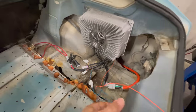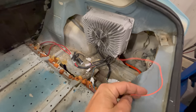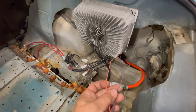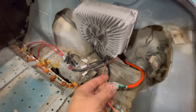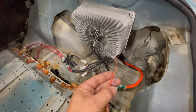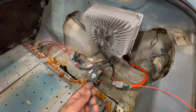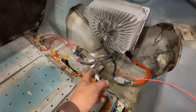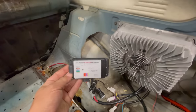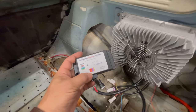That's it for the charger wiring, and then I have some of the computer wiring sitting here. I have two wires that run from the charger connector — one is the proximity sensor and one is the signal — and these will have to be run to the ECU that provides both CAN bus communications and also runs the charger. These wires right here are the CAN bus communication wires. These will be connected from the charger to the computer right here, and I need to mount this somewhere and wire up a bunch of little wires to turn it on with the ignition.